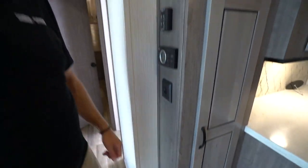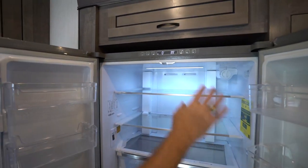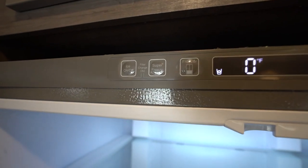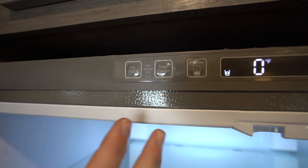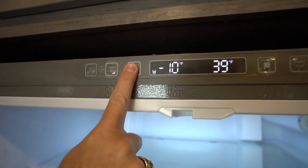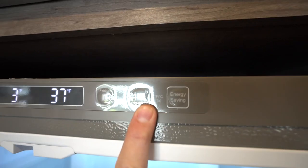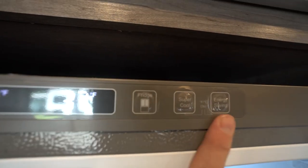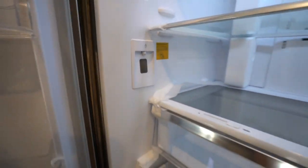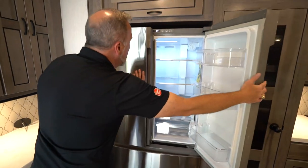You do have the Insignia residential-style fridge-freezer combo in here. These are great because they have the water filtration system and the ice maker. You can set it to super freeze, which doubles the workload of the compressor to cool and freeze everything — it runs about 14 to 18 hours and then shuts down. You can adjust the freezer from negative 12 to 6, and the fridge temperature the same way. There's also a super cool mode for a quick cool-down and an energy saver mode which reduces the load of the compressor. You got the water dispenser and ice maker down below — just a great residential fridge that makes this cottage feel more like home.